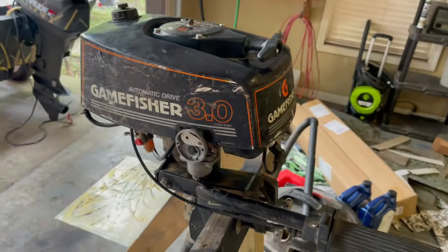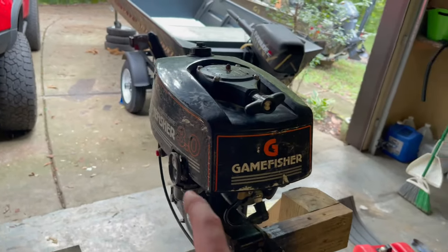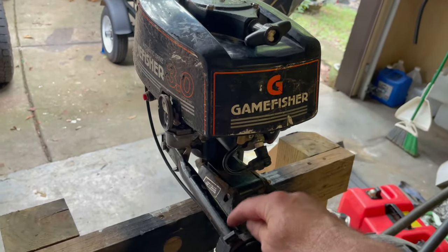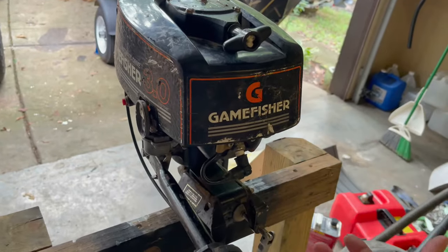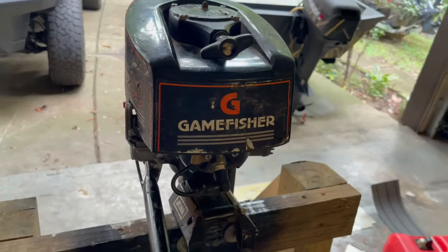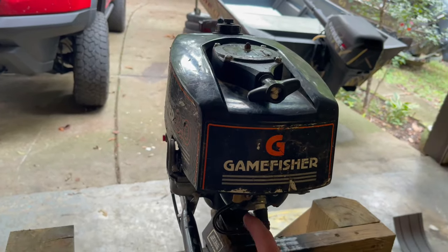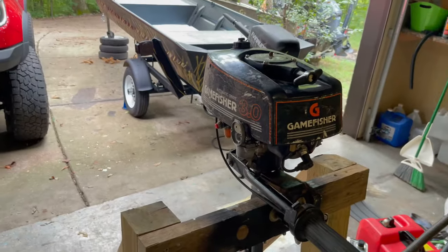But it still was not firing. I tried this morning, and it still wasn't firing. I took the plug out and tried to check for spark again, and it was sparking. It seemed to be fine. I was just tightening the spark plug by hand, but I thought, why not go ahead and tighten it down pretty snug with a socket. I cranked it up, and sure enough, it caught the first pull.